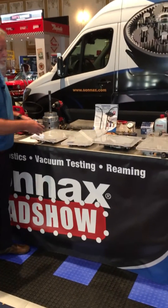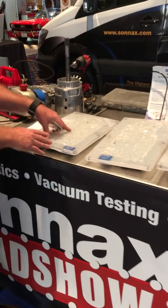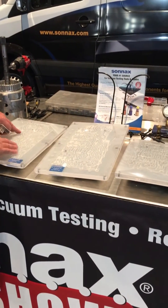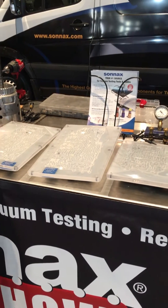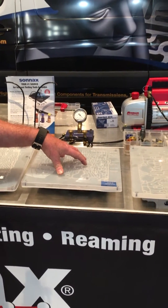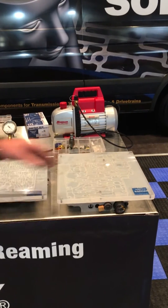This year, we have three additional families that we're going to introduce here. We have the 6L series — the 6L45 up through the 90. This is a two-plate series because we've got an upper and a lower valve body that we have to be concerned with on the leaks. Along with that, in the 4-speed family, we introduced the 4T65E as well as the 4L80E test plate.